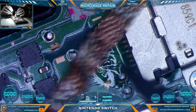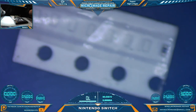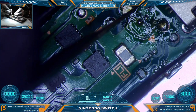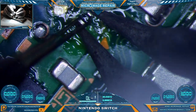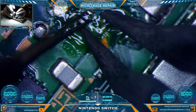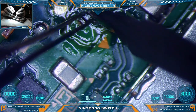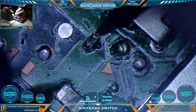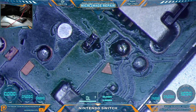Let's wake up the low melt. The Pico Prince is having a little bit of issue here. There we go. Looks like I need to order more fuses — it only took almost two years to get through these. I call them invincible for a reason. It got stuck on my tweezers in a way where I can't really get into position. Let's just bring in the big boy and see if we can get it on there. Check and see if we have continuity — we do in that direction, and we do in that direction. Very good. Now let's see if we blow it.